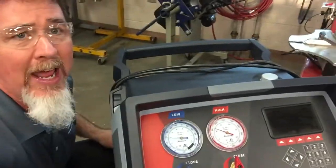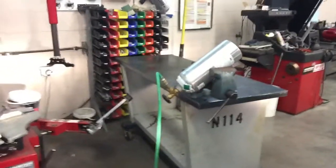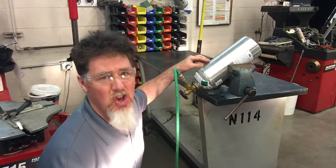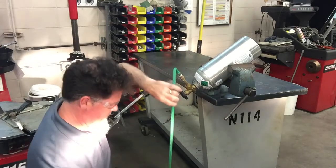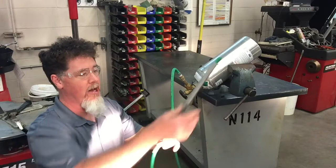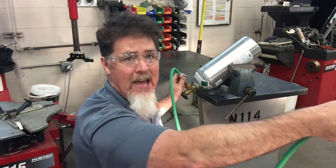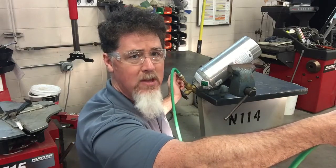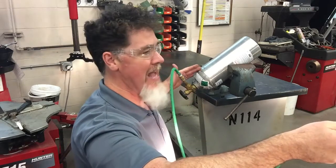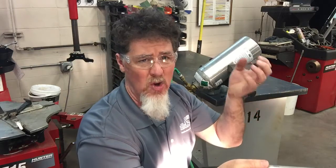Let me show you what I have set up here. Here's my canister of CO2 — you can get that at any welding shop. I have a welding hose on it, about six feet of it. Then I have a steel rod at the end that works as a wand. I can come over and put that on top of the H-Valve on the power dome. I can open and close my valve, and I want it upside down so I get liquid CO2 on that power dome to get it really, really cold.